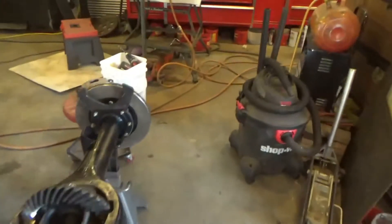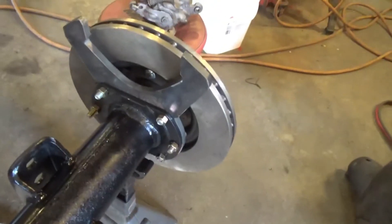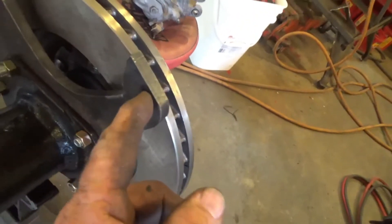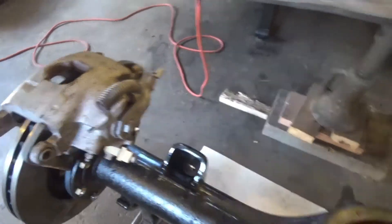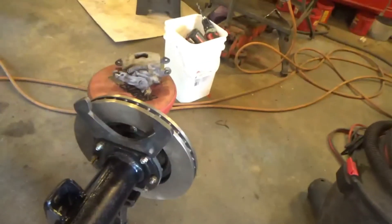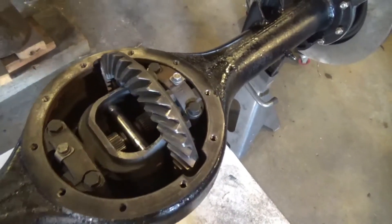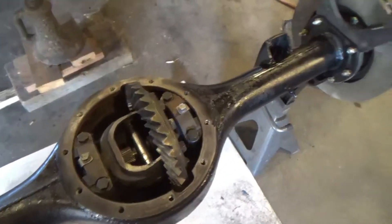Those brackets my buddy cut up. I drilled the mounting holes — they're just mocked up and bolted on because I still have to drill the holes and tap them for the pins for the calipers. There's a caliper just sitting on there to figure out where they go. Got to drill those. The 373s are in there now; the ugly rusty 411s are sitting on the floor. There's all new bearings.